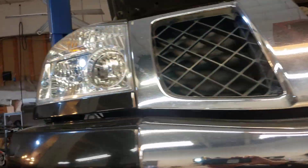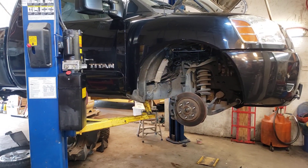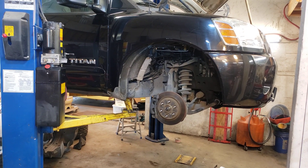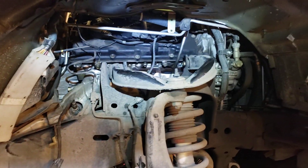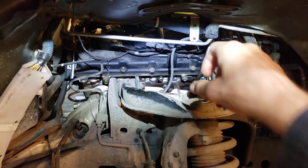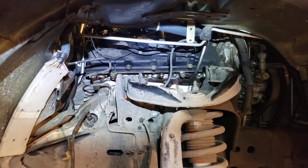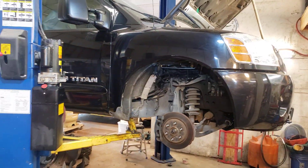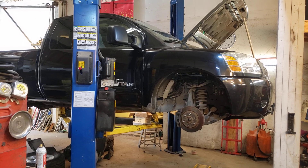You can't have cracked exhaust manifolds, so that's what we're doing in the shop today — making somebody's life a lot better. Gotta change those manifolds. It's the same manifolds on the Nissan Armada and also the QX56 — some type of SUV with the same 5.6 liter V8. Also be sure to disconnect your battery before you get going, and try not to break off any of your nuts for your exhaust hardware. That would be bad — it's tough to drill those out. Take your time, soak them with penetrating oil, use a little heat if they're rusty. Good luck. I'm wishing good luck to myself. This is not a fun job but I took it on and now I gotta make it right. It'll be better than ever when we're all done.